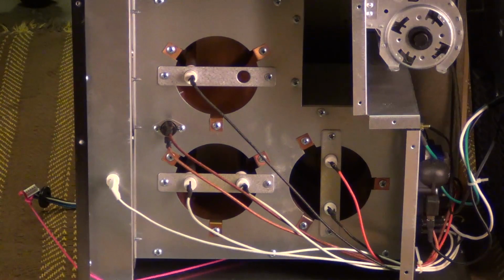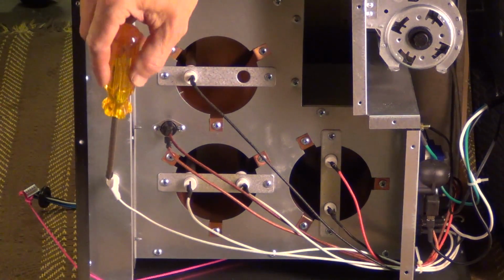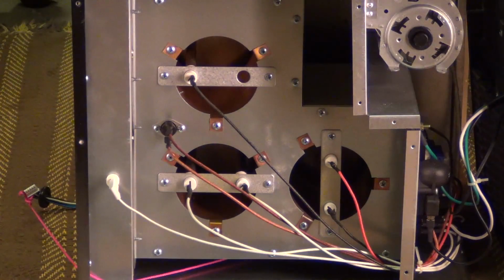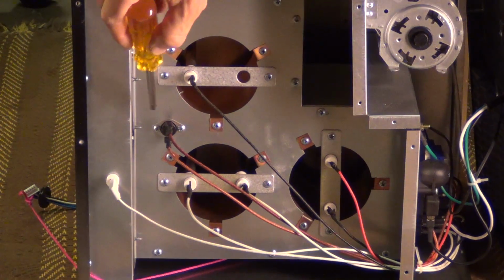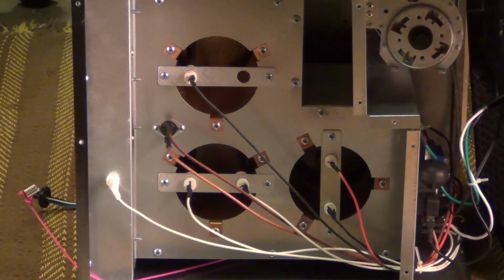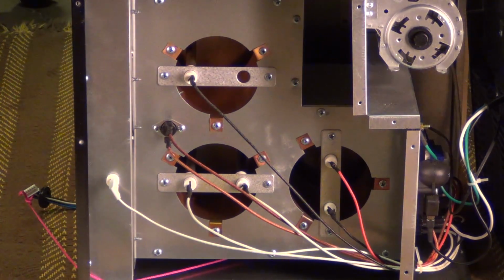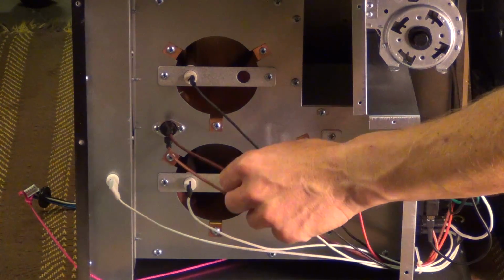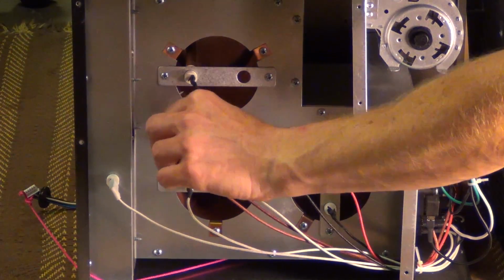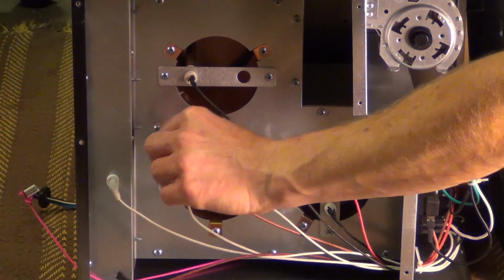As you can see, you've got heating elements. Appears to be one here, 2, 3, 4, 5, 6. And what I'm really after is this thermostat. I believe this is what's faulty on this device, which is like a $2 part. It's a safety switch. I did mark these wires so that I know which way they go later. So I'm just going to pull these off.